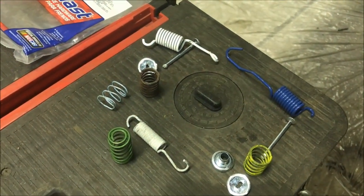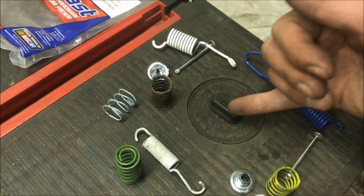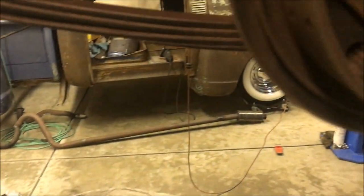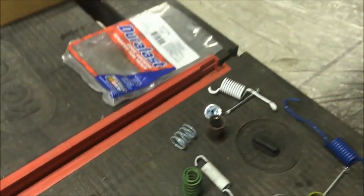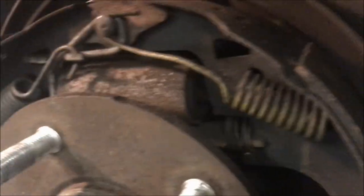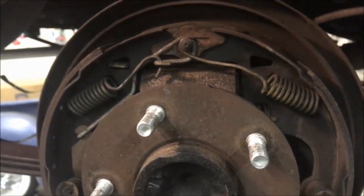These two are on the edge. I should have two yellow springs, but since I don't, I'm using one of my old ones — I think this bag was opened and short one of those springs. These are the two pieces that go on top of those springs. There's a plug for the back. This is the spring underneath — this goes to the self-adjusting arm there. And this goes to the e-brake, which is on the back side. And once I tear this apart, you can see it. And then there's the brake piston for your normal stopping power there.